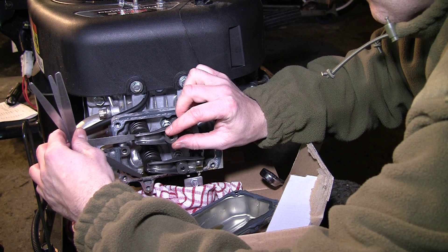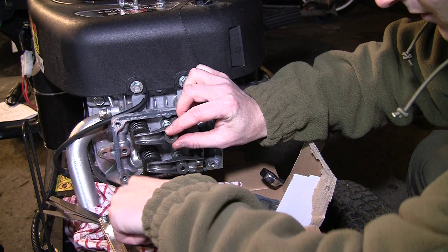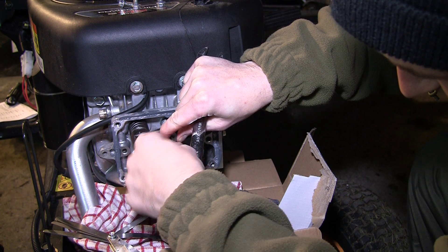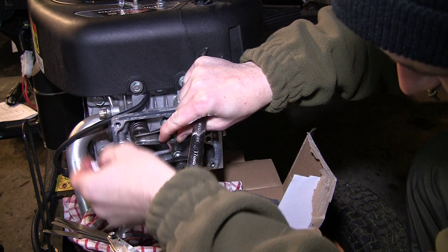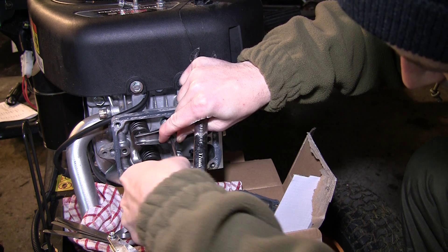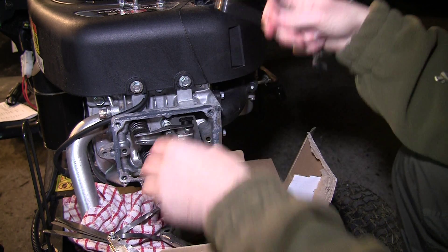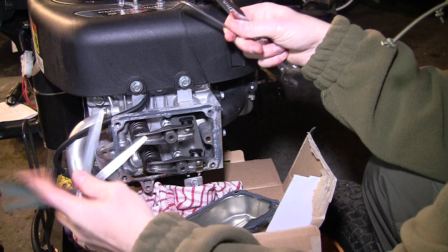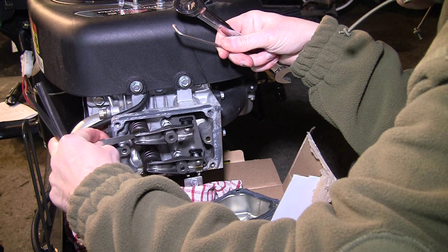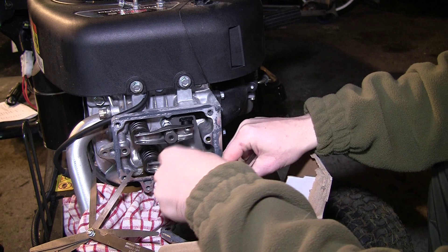You can adjust it with your fingers — it's no problem. Then tighten the screw with the Torx key. Check the gap after — you have to unfasten it and then do the inlet valve as well.